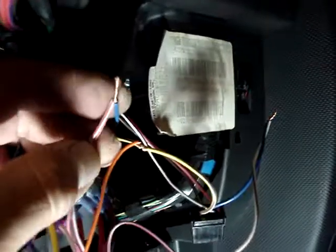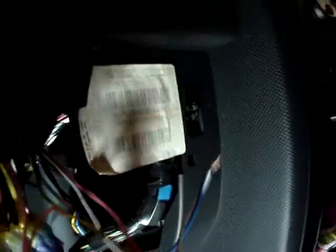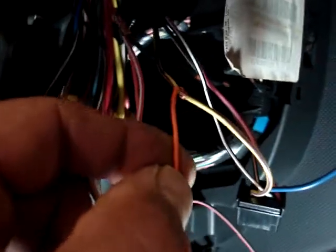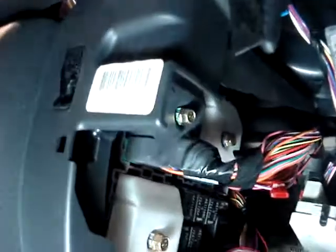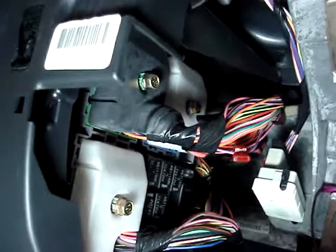You've got to be conscious of these connections — you don't want to get them backwards, it won't work. You want to have the pink and the white with red on the vehicle side of the cut, the white with black on the plug side of the cut, the orange to the J1850, and then your analog lock wire is over here at the BCM, the top harness, the one with the tap on it — it is pink with violet.